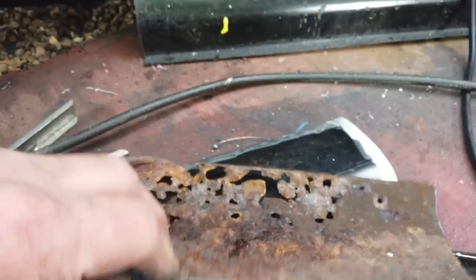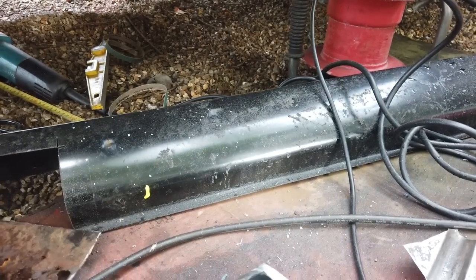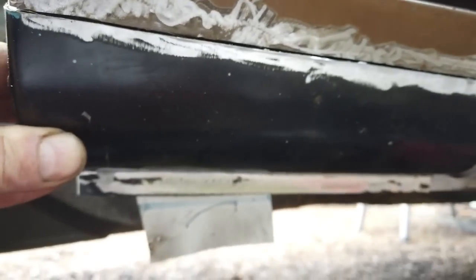Okay, anyway, that's handy to use to get that line horizontal for you, that line there. And then when you offer it up, if you've done it all right, it fits in like this, and in our case, looks on our side, or whatever we want to call it, and it's absolutely snug. You can see that line stays straight all the way. I've got to push up that end, but that closes up with about a couple of mil. Here it's almost touching, that's fine, the weld will just burn through, and that makes a nice profile.